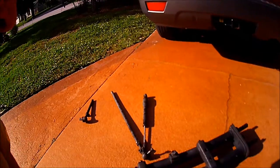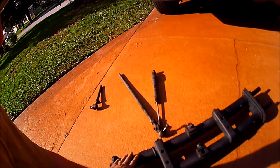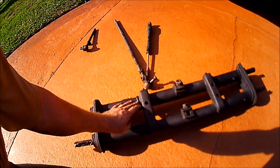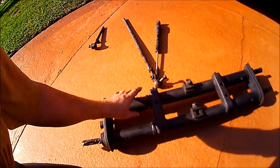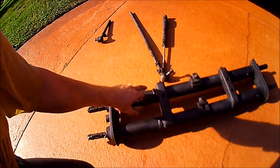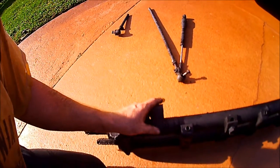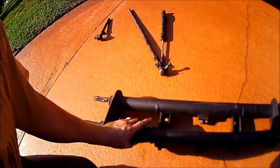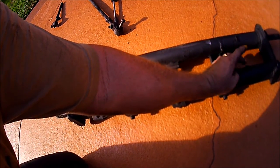So, now that I got the battery going again, I took my 2 inches out of this side of the beam. I cut along here with the Sawzall. I didn't go all the way through because I left the torsion leaves in. And then I got the sides off, and I took the 2 inches out of the sides. I had to relocate my steering stabilizer mount. I have not yet relocated these bosses. They're to keep the beam from the steering box from sliding over.